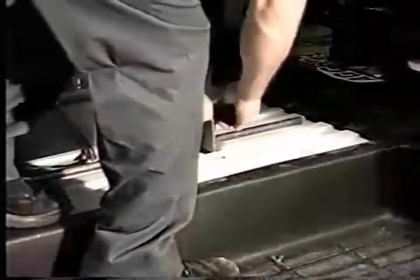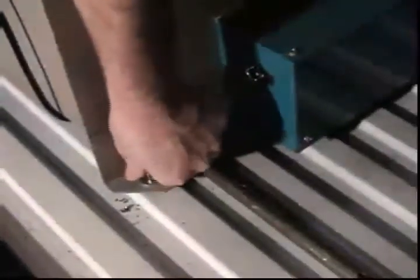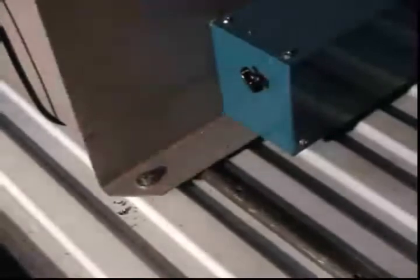Insert the proper length bolts through the flooring and frame. Remove the metal rods. Add spacing washers and lock nuts to the underside of the frame and tighten all bolts.